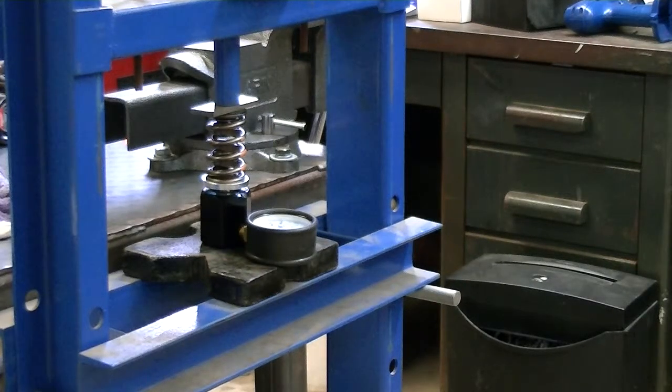But anyways, I put my valve springs in my Cummins 12-ton press and set it on my ProForm spring tester, and I have a calibrated spring that I test that with every time, and it shows right on every single time. So it's fairly accurate. I like to find 2 or 3 other springs to try a couple different ranges. Basically, it checks it in kind of a mid-range.